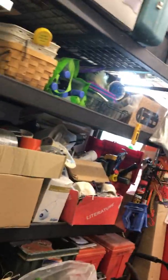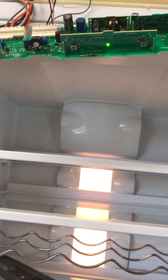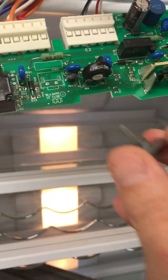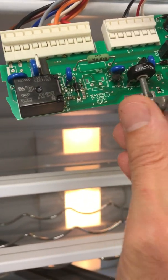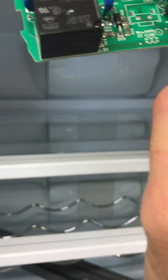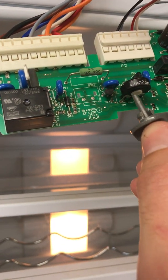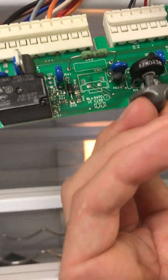Everything's isolated, we're on plastic here. Turn it on. What we should get now is the green, which is good. So the procedure is: turn the fridge on to the halfway point. Now if I turn the fridge to off, the light goes off — it does actually turn off. Sneak it back a little bit, it registers and turns the fridge on. Put that onto the halfway point.